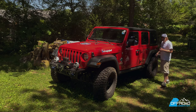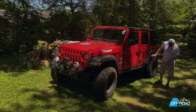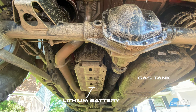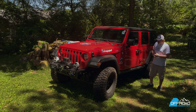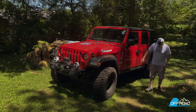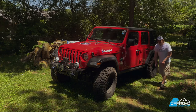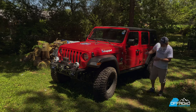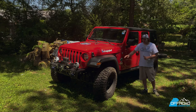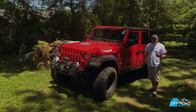What also came with this was the tow package — just the trailer hitch and trailer connectors. As far as the undercarriage goes, I do have the lithium battery back here and the fuel tank on the opposite side. I'm running into a problem trying to find a good skid system for it. I priced out some aluminum skids and it's going to cost me probably around two grand, but you've got to protect it. The transfer case does have a skid on it along with the battery and gas tank, but nothing on the engine. You can't just get a 3.6 engine skid plate and put it on a 2-liter — there's just enough changes that you can't swap one for the other.